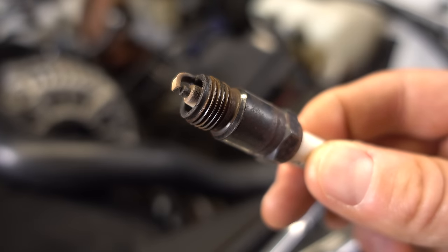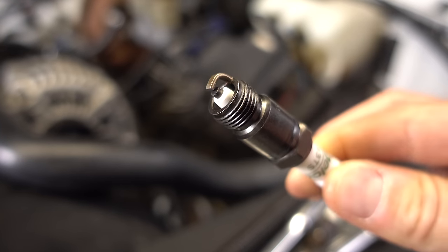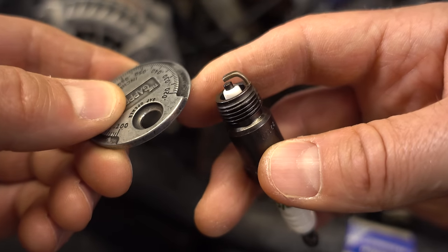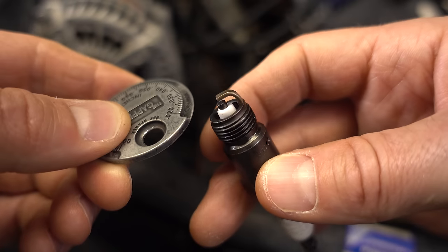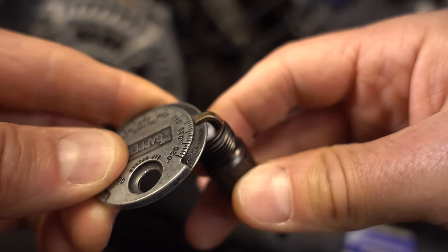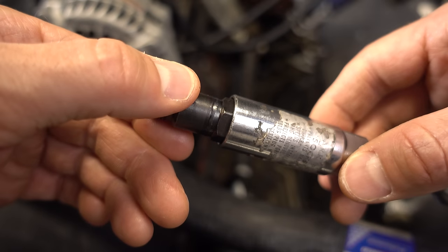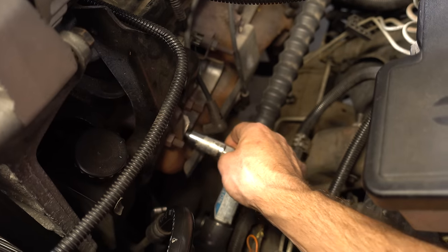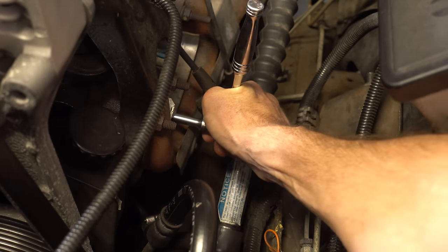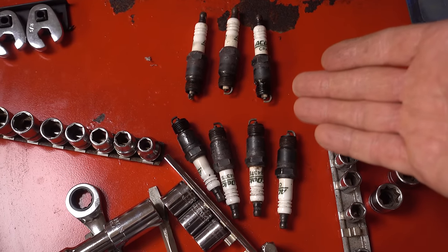In the next few days I'll be doing a full tune-up on this truck, but for now I'm going to replace the old spark plugs with fresh new ones. Here you can see the old and new plugs side by side. I do have to gap these plugs — the manufacturer recommends 0.035 and these come out of the box at 0.040, so I used my gapper and got it to just about 0.035. Then I slide it into my 5/8 spark plug socket, thread it in by hand, and finish it off with my ratchet. Since I already have all the old plugs out, it's no problem to go ahead and install all the brand new ones.